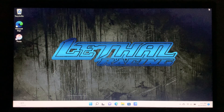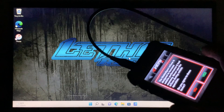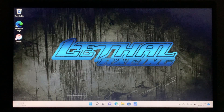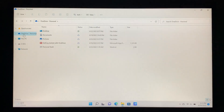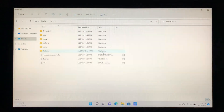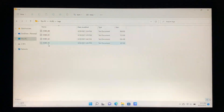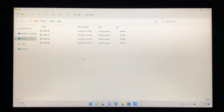Alright guys, now that you're on your laptop, you want to hook up your Diablo tuner using the USB Mini Type-B cable. You need to know which one to use — I actually had to go to Best Buy to get it because no other store had it. Then go to My PC, choose the i3 device, go to Logs, and all the ones you recorded on the tuner will pop up here if they were saved.